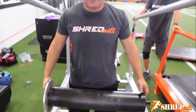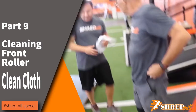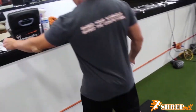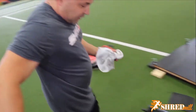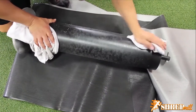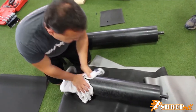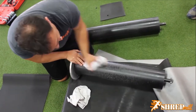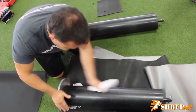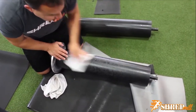When you take the roller out, carefully grab it on both ends, slowly bring it up, and it comes out like this - then duck and you're good. Take a cloth rag; if you have a rougher surface, use a textured washcloth and go over the roller carefully. You can see the particles coming off. It's very important to get these particles off before you put the new belt on, otherwise you've eliminated the benefit of putting on a whole new belt. Just kind of go up and down and roll it around.